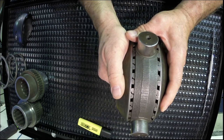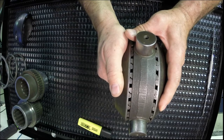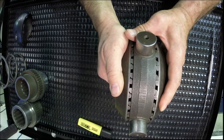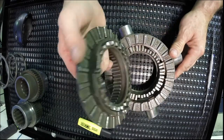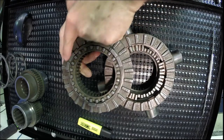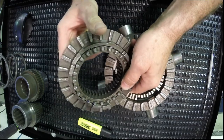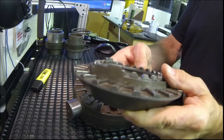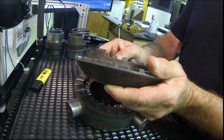It's the traction between the ground and the tire that actually causes one of these clutches to unlock. These things are locked so well that you can actually lift a wheel off the ground and the other wheel will still drive. So it's not like a true limited slip in the most familiar sense — this is actually a locker that can unlock. Opening this up, you can see the square cut teeth around the outside perimeter — that's what actually does the driving. In the middle or the inside circumference, we have a ring that has angled peak teeth, and those are the teeth that actually cause this thing to unlock.